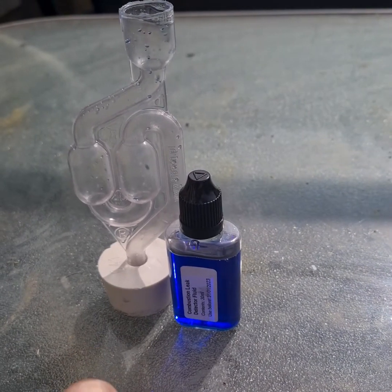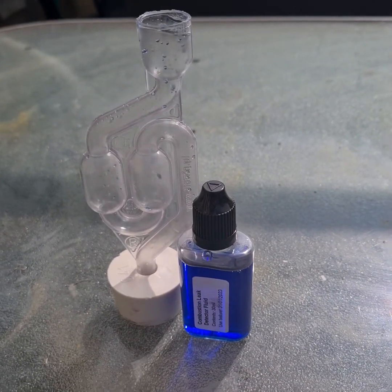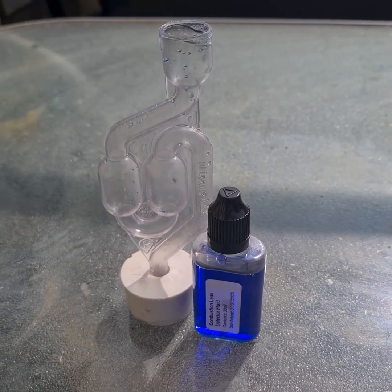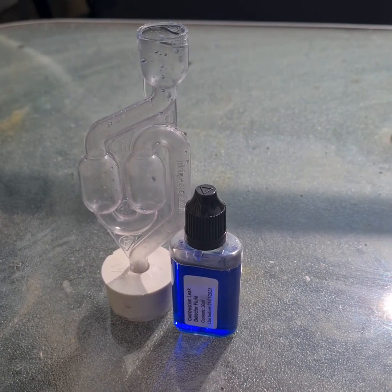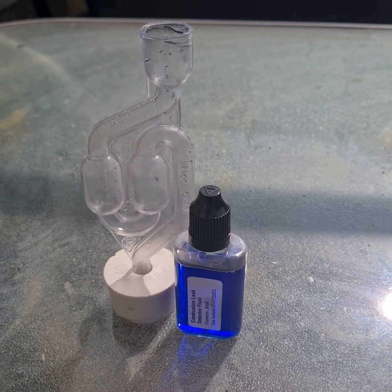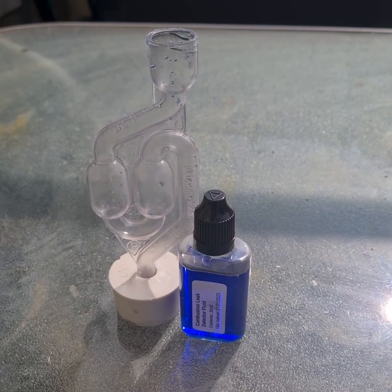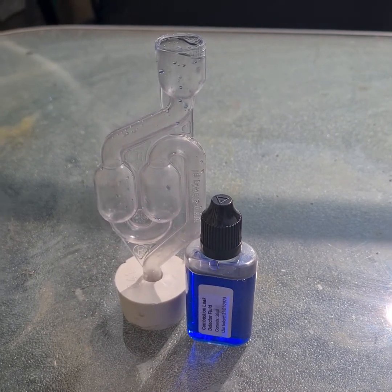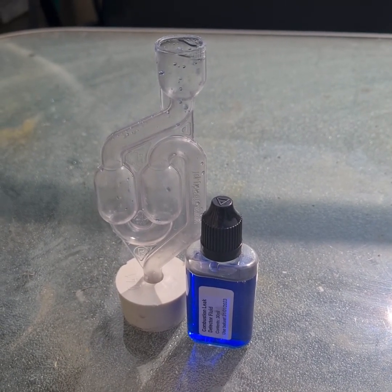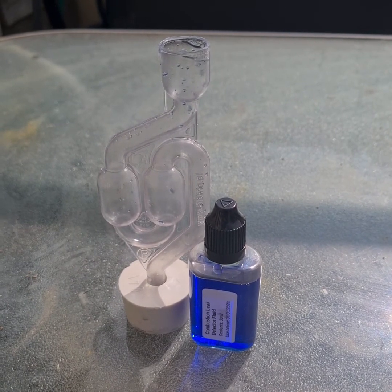One thing I forgot to mention — this kit works for diesel or petrol cars. I've got two minis: one petrol, one diesel. I already changed the head gasket on the petrol one last year because that gasket was gone. I bought this second diesel mini because it had possible head gasket problems, but I think it was just the vacuum seal on the lid and the overflow pipe. It's a vacuum-sealed coolant system, and it was letting air in and liquid out because it wasn't sealing properly.